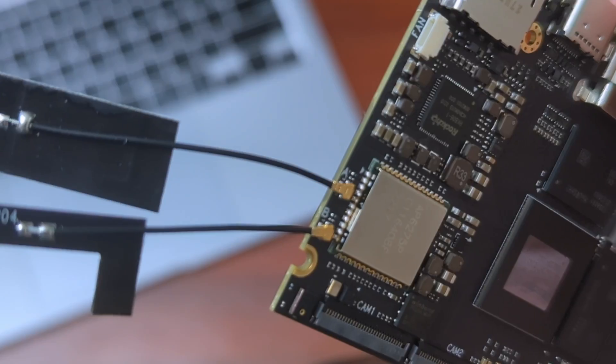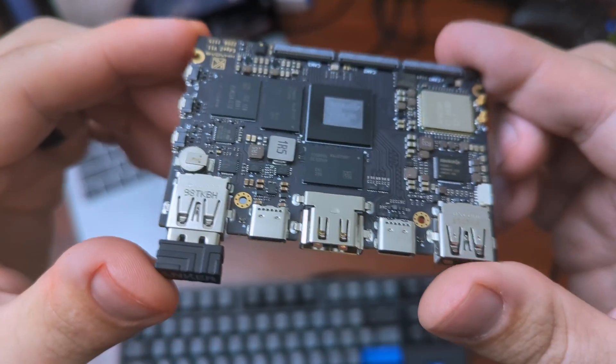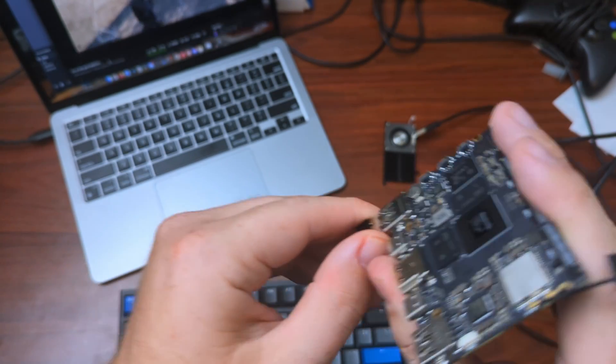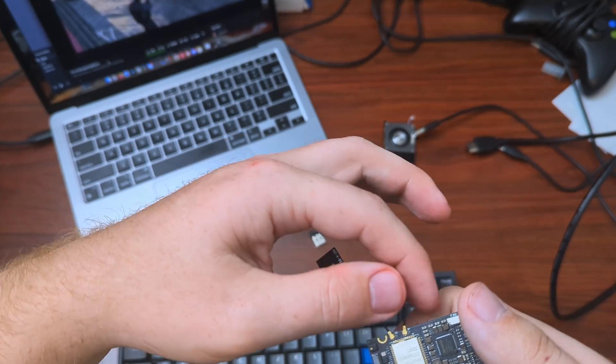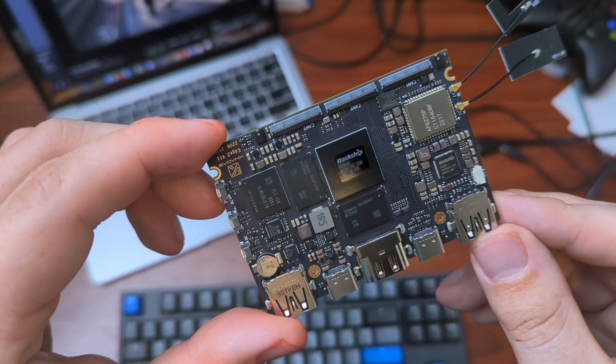The little A and B connectors are for Wi-Fi and Bluetooth. Looking at the manual, I still don't know which is which, but the rectangular one goes into A and the other goes into B. On top of the board we have all the various chips and components including the main CPU, eMMC flash storage, RAM, and various other chips to make the whole thing a fully functional computer.